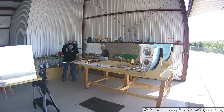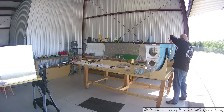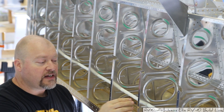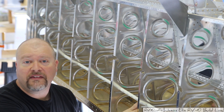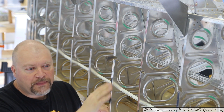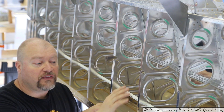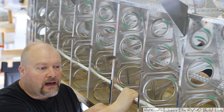I got a message a little while ago from somebody asking about the white PVC pipes that I'm using inside the wings - it's not actually PVC. I had some people ask me what this stuff was. It's actually called Shark Bite conduit. Basically I'm running that through the wings instead of using those little black grommets, because I want to have all the wires enclosed and not just kind of flopping around. At the end of the wings you're going to have the lighting, I'm probably going to put GPS antennas out there as well, and on the other wing you've got the pitot tube - I just didn't want the wires flopping around.